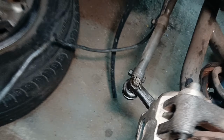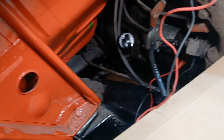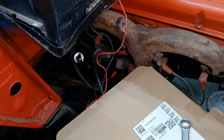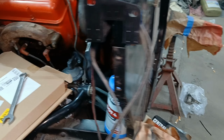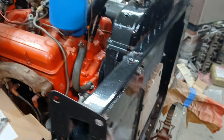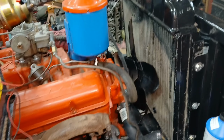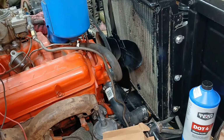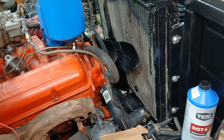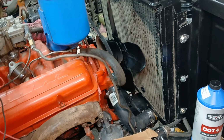But yeah, we did run it off of an auxiliary. You can see the tube down there. It was pumping like crazy. Got it running. Just used some old steel lines that I had. I straightened them out. And Pops had a used transmission cooler versus trying to run the transmission lines into, of course, the back of the radiator, because this is an automatic radiator. Didn't want to take a chance on it leaking, or I mean, eventually I will probably bend up some lines just so it looks more original.